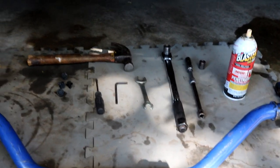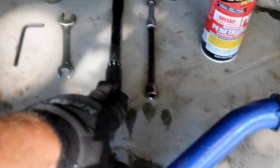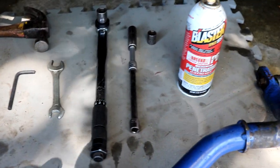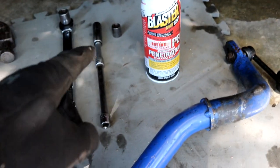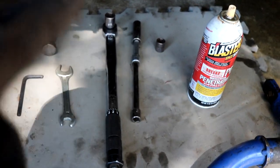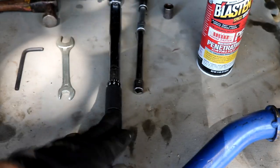The tools in front of us here are what you're going to be needing. If you don't have air tools — which I do not at the moment — I'm just using hand tools. You're going to need a ratchet with a pretty hefty handle to get a little leverage, because there are some bolts up there that have probably been there for a long time. Make sure you have that, plus a 17 millimeter socket. You're also going to need a 14 millimeter socket — make sure you have a deep well 14 — a couple of nuts require a deep well socket.